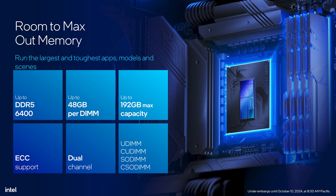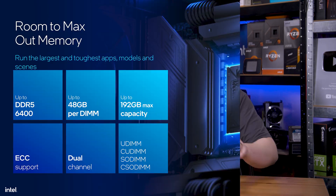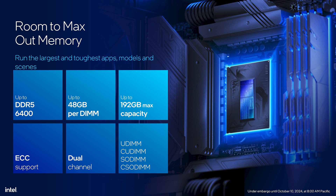They also talked about overclocking. The biggest topic was memory, which has a pretty major change — CU DIMMs, that being clock driver unbuffered DIMMs. These memory modules have a clock driver chip built onto them that re-drives the signal from the memory controller, which makes higher speeds considerably more stable. According to Intel, 8000 megatransfers per second is the new sweet spot for overclocked memory. The new base standard — the max speed that won't void your warranty — is DDR5 6400, although for anything higher than that, you'll likely want a CU DIMM module for that stability benefit.